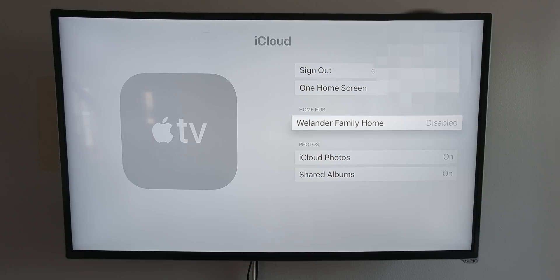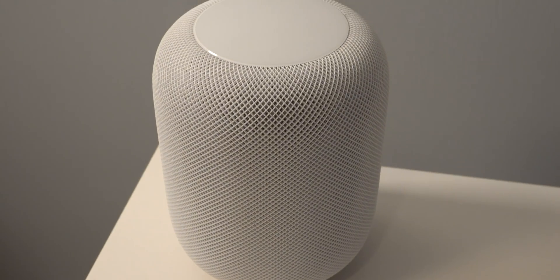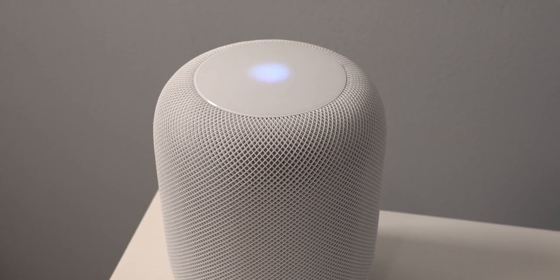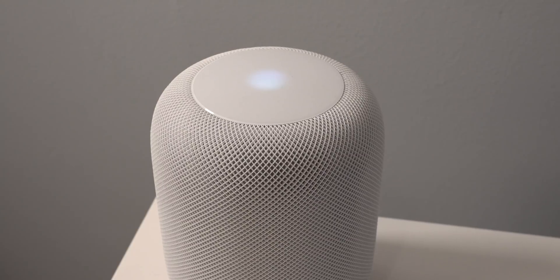I had this for a while where my HomePod was down in the basement in my office, and my Apple TV upstairs was the main hub, which was working well. But then for whatever reason — sometimes if the network powered on or off or something — the Apple TV would cease to be the HomeKit hub and my HomePod in the basement would become the hub. The problem was that accessories on the second floor were having difficulty communicating with the HomePod because it was a long ways away, and the HomePod really wasn't set up where it was to be a hub.